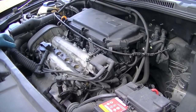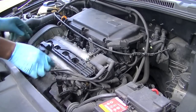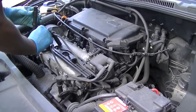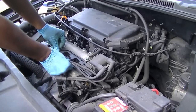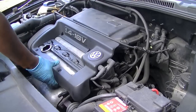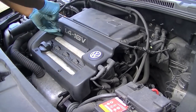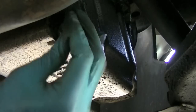Once all spark plugs are done and air filters are done, it's time to start putting things back together. Put the plastic lead guide back down — it's important because it tells you which order the leads go in. If the leads don't go in the right order your car will be misfiring and it's very hard to work out. Make sure you use that guide system. The plastic panel goes back on in reverse, and then put your five millimetre allen bolts back in.